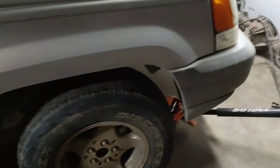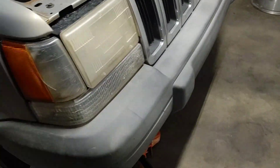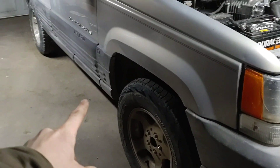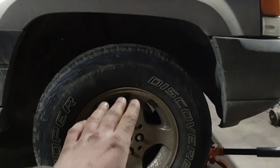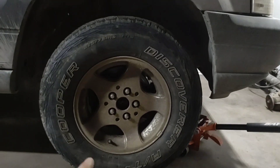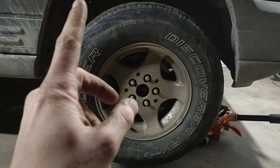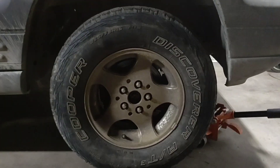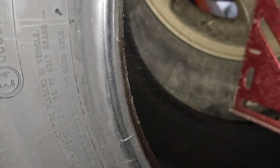Since I deleted the AC I haven't got rid of the condenser yet — I'm going to rip that out. I'm going to take the bumpers off, set some jack stands under the frame, and let the axle droop three inches so I can see how the tire is going to look with those pucks in there and see how much suspension travel is left before the control arms max out or the shocks go to full extension.